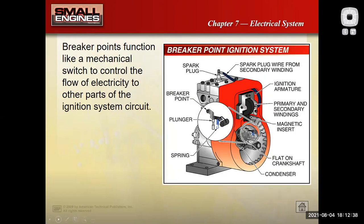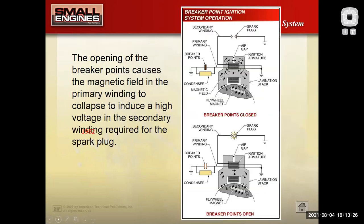Okay, so he's talking about spark plug gaps. Old ignition systems on our cars and on our small engines used to use points. So for Briggs & Stratton, the cutoff point was, I want to say 1982, when they moved away from breaker points and moved to electronic ignition. On our cars, we moved away from breaker points in the 1970s, moving over to electronic ignitions in the late 70s. Motorcycles, again, 70s up to early 80s would be points. And then as we went into the 80s, we moved over to electronic ignition. Everything today is going to be electronic ignition. We're going to get rid of those mechanical points and condenser assembly in there.